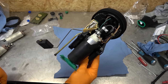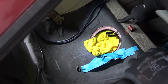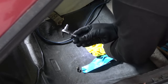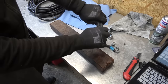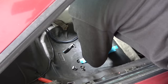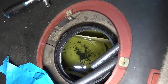It's snowing outside — yesterday was 20 degrees. We need to replace these two rubber lines on the fuel pump; they are hard as a rock and will leak. I've seen some people cut a hole in the chassis to access the clamps, which is ridiculous — don't do that. They're easily accessible with a small ratchet. It's not even rubber anymore — it'll actually take you more time to cut a hole than to just replace the hoses. Now we need to remove the old fuel and clean that out.